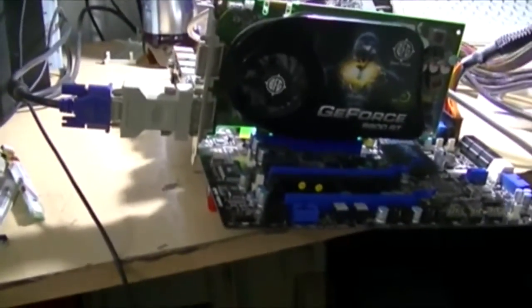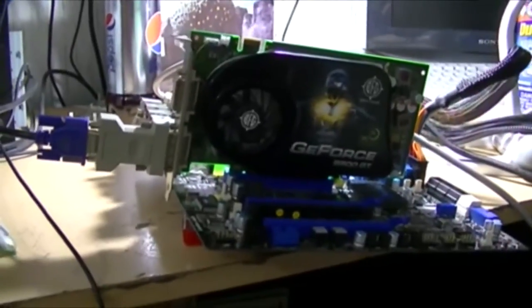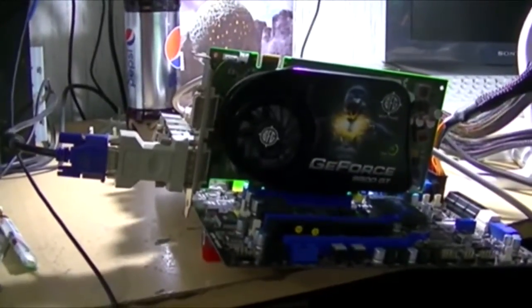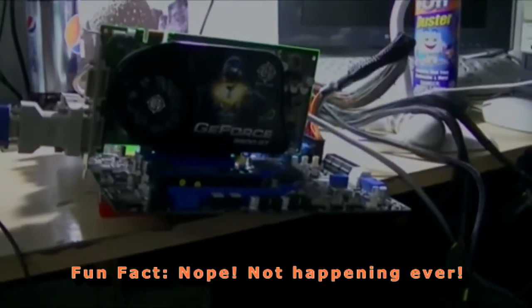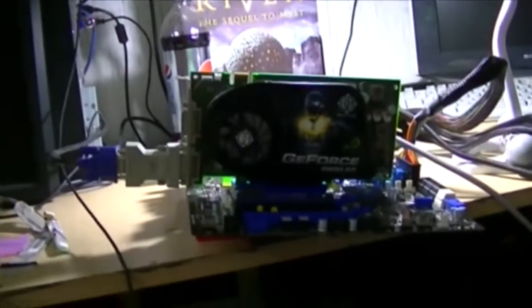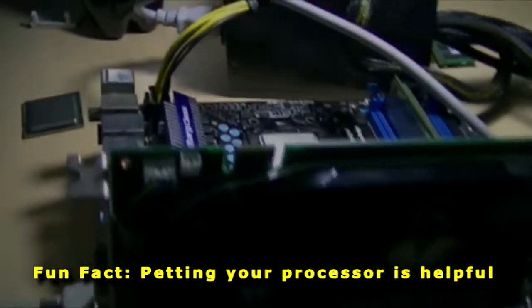How do I want to do this? Because I've got to find a cooler for this thing. The sick thing is I had a cooler for this — it was a pretty kick-ass Intel cooler — but I think I may have ended up throwing that away because I thought I'd never have a LGA1366 motherboard. I'm going to have to rig something up, probably. I wonder if the Xeon just needs a BIOS update to make that work, or what's going on with that. I'm going to have to Google that a little bit, but the big hurdle is over.